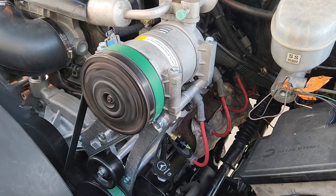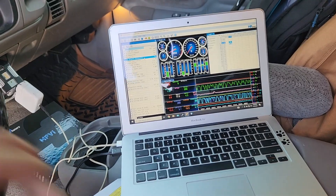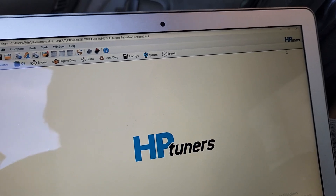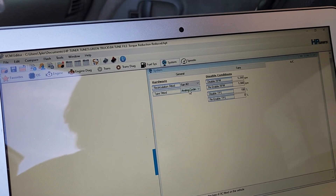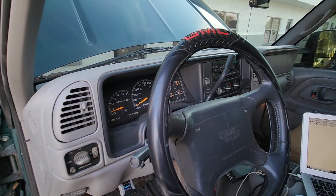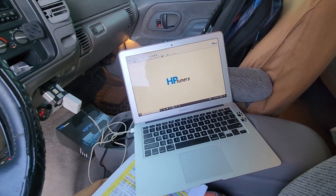Compressor is running through all the stock wiring and pressure switches of the truck. If you have everything wired correctly and changed your settings in HP Tuners, make sure the P0530 AC refrigerant pressure sensor A circuit is set to 'no error reported.' Also make sure your AC tab in system configuration is set to 'analog cycling.' We now have perfectly functioning air conditioning on this truck. Hopefully this helps somebody. Please subscribe to the channel, and I'll see you next time.